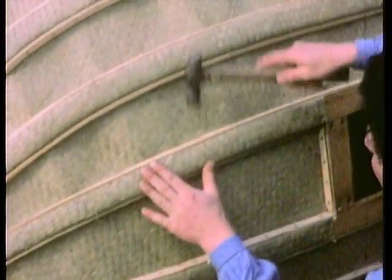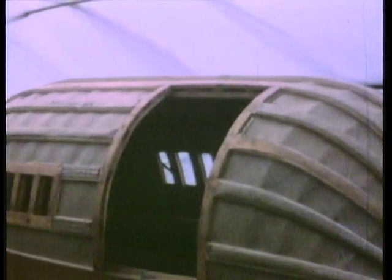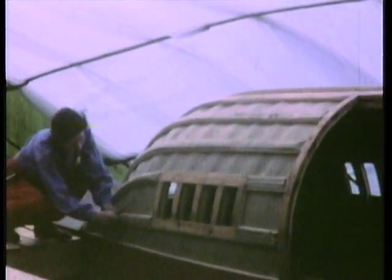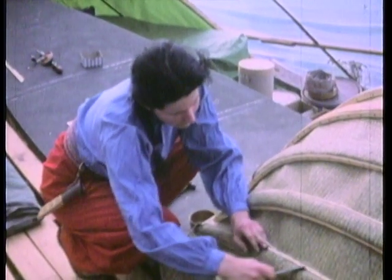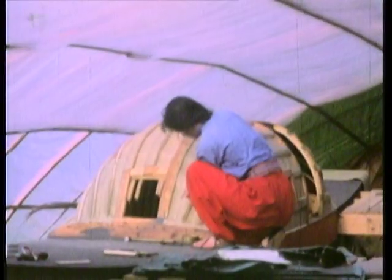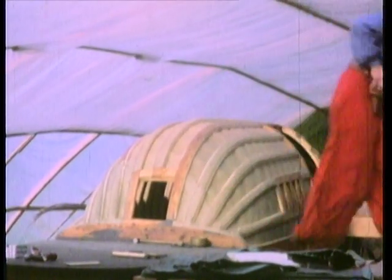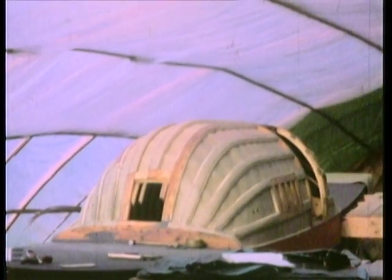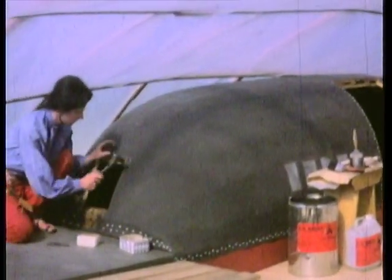Meanwhile, our runner is fastening down T-mats over the cabin roof. The matting looks beautiful and creates a porous layer to avoid condensation. We fit a layer of insulation between the ribs and over all a layer of tinfoil to make a curved radar reflector. The final coat is canvas, painted with chlorinated rubber paint.